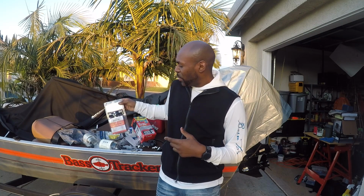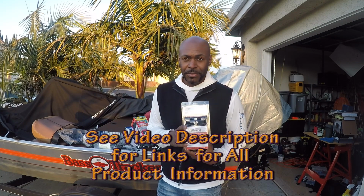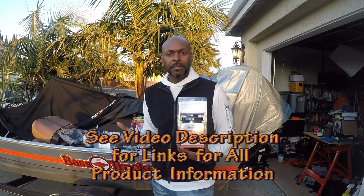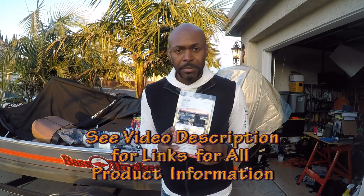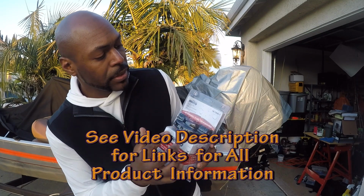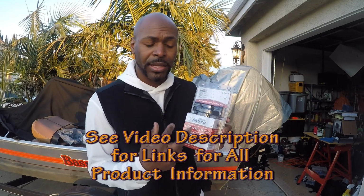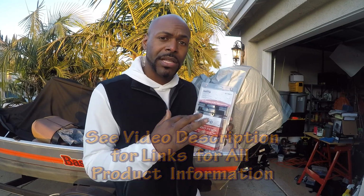I called up one of my local places to say, hey, do you all have one of these fuel filters? They said, yeah, it's $50. And they gave me a part number. This is actually one made by Sierra. The part number on this one is 187848-1. It is actually a direct replacement for the Mercury/Quicksilver one.